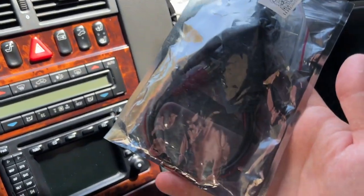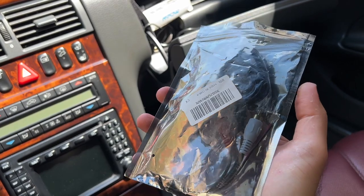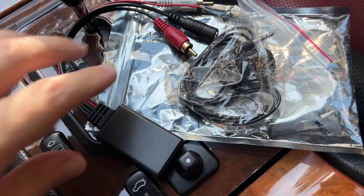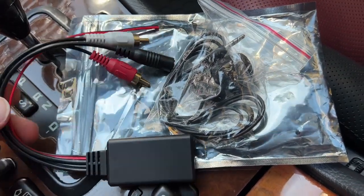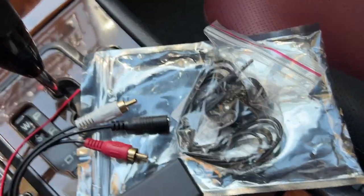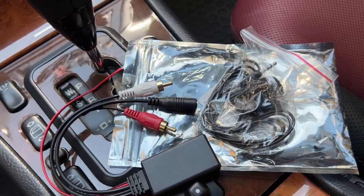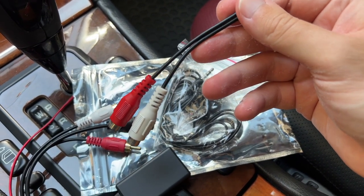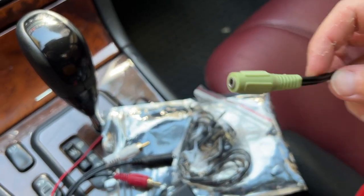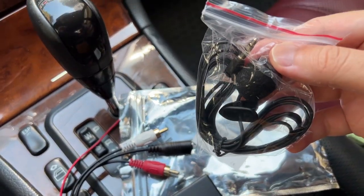I did find a great solution — I'll post a link in the description. This will wire into the car with power and ground and then plug into the auxiliary. The package comes with this module that streams Bluetooth. We have the RCA left and right, an aux port for a microphone which is included, and the power and ground. You will need to buy an adapter — it plugs into the RCA red and white, then goes to auxiliary, which you plug into the car's auxiliary port.